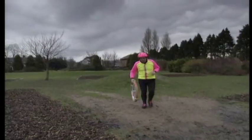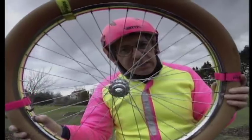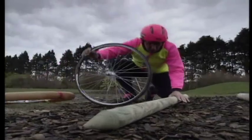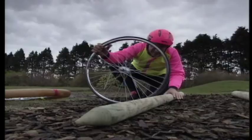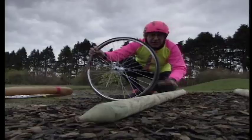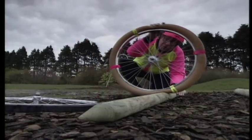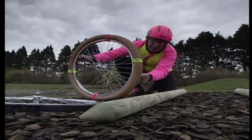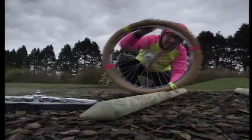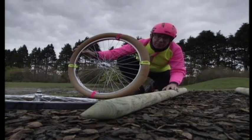Obviously it's going to be much better on really rough ground. The reason for that is that this pneumatic tyre reduces the unsprung weight of the bicycle almost to zero. When this solid tyre comes along and hits an obstacle, there's no give in the tyre at all, so it's got to go into the air — all the energy in the bicycle is wasted because the whole lot is being lifted off the ground, not only the wheel but the whole bike and the rider. Whereas when this pneumatic tyre comes along, it squishes, and so it runs almost straight over without rising at all. As long as the bumps are smaller than the thickness of the tyre, all that happens is the tyre squishes. You lose a little bit of energy in the squishing of the tyre — it's like riding very slightly uphill — but you do not have to lift the whole bike and rider into the air every time you go over a bump.